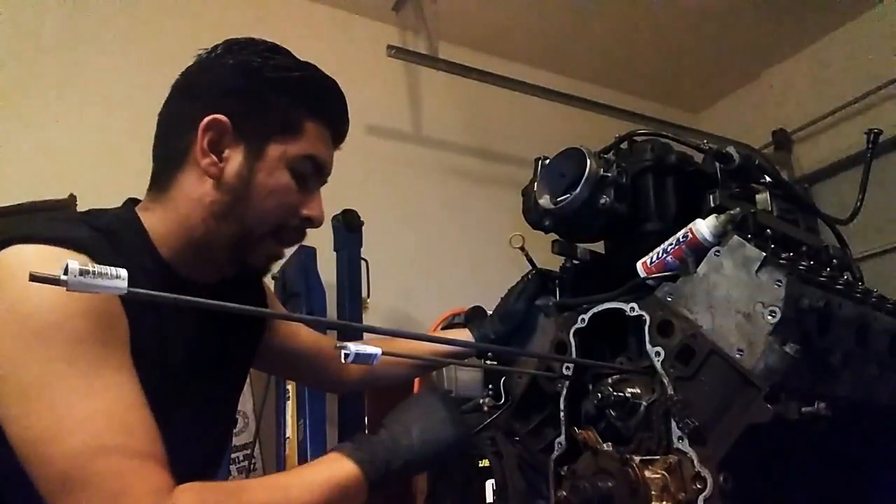What I'm going to do is push each pushrod in just so I can hear them touch the cam. If you push that pushrod all the way through and it goes through, it means your lifter went straight through. I'm going to use some of this excess oil for the tips of those pushrods. I'm going to take off these gloves, and these rods can come out. See, I have black tape on there — this stops to keep the thickness and tension on those lifters.